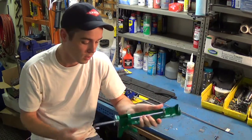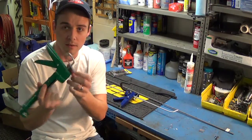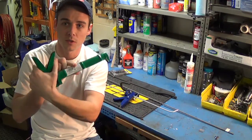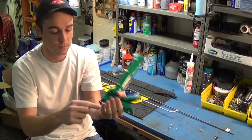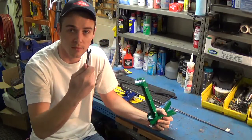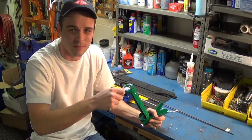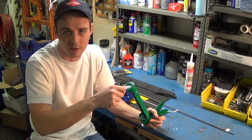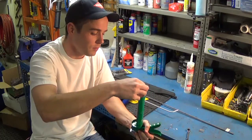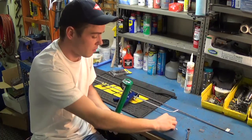What I'll do now is push the rod all the way forward. You'll see where it's bent around in the rear. All you need to do is take your hand and hold that in place — put your thumb around the handle and cup the end of the rod in your hand. Take the 8mm wrench and untwist this nut off the end. There's very little torque on it, so it'll break free easily. Brake that free and unwind the little nut.